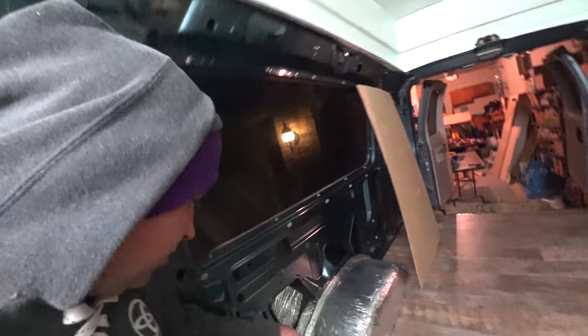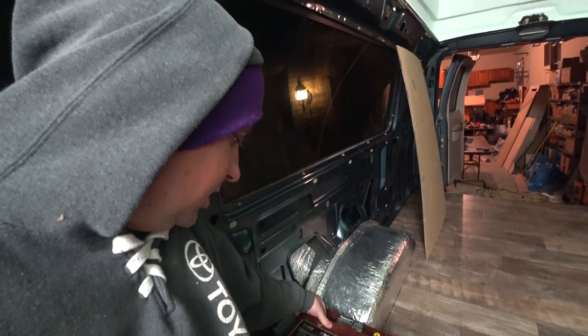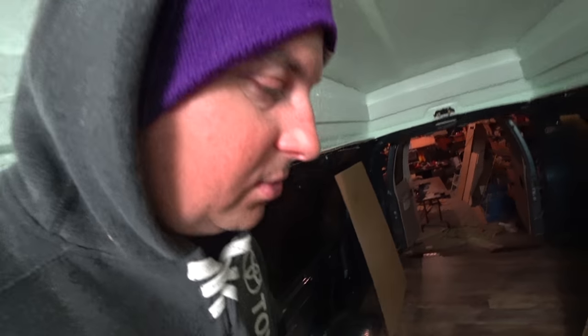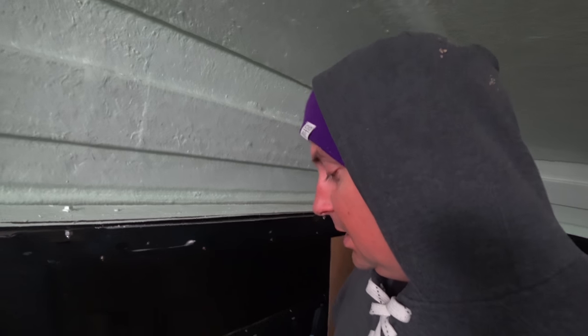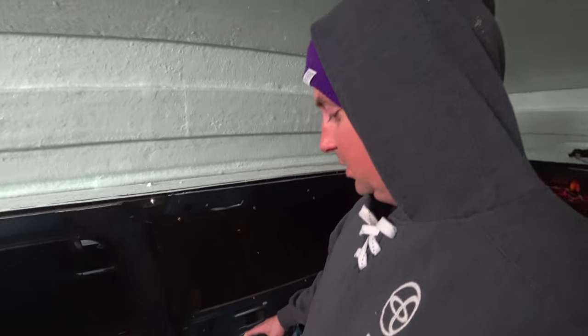So this is an incredible battery. It's a Trojan 31 AGM. I don't remember what group it is. But it's rated for 100 amp hours. And we have destroyed this thing. Well, we should have destroyed it, how we've treated it. We've drained it down below 10 volts multiple times in the Airstream. So 100 amp hours, that means 50 usable amp hours. We'll get one more. That'll be 100 usable amp hours. That'll be plenty for what we're ever doing in the van.